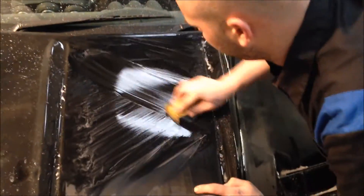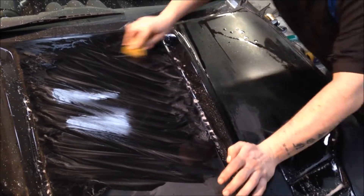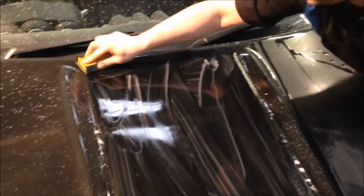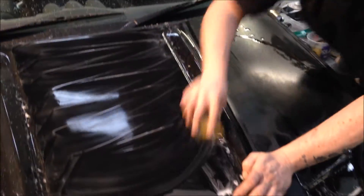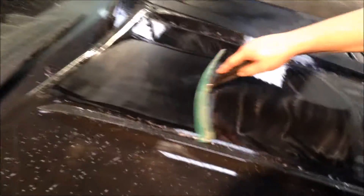So I thought we'd do a proper detailed video on how we do it, what we do. What I have done is we've done this 350 and I deliberately turned my pressure down on the gun because I knew I wanted to do a video anyway, and got sprayed really close with a clear so we'd get like a peel. And then I can show you guys what we do to get rid of it.